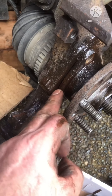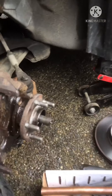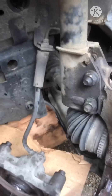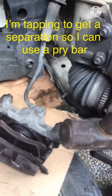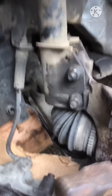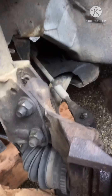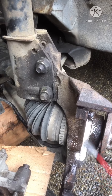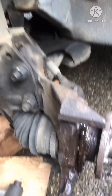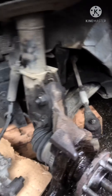This hub has to separate from there and it's probably going to be tight. You're going to need to tap it back and forth to free it. If a little hammer doesn't work, you need a bigger one. It's slowly coming loose — you can see the gap opening up there. When in doubt, add a little more penetrating fluid. Once it loosens up a little bit, you can get a pry bar in there and pry it from side to side.